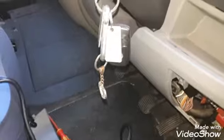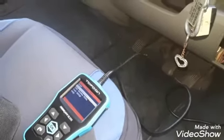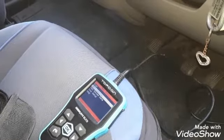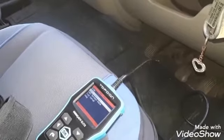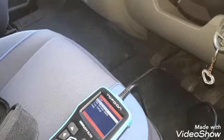Okay, I think I'll have to go back with this to the supplier of that fuel filter housing and request a replacement. Obviously, if I keep running the engine like this, that connector will get flooded again, and then it will show a fault on the engine as it did before. Because when I replaced the fuel filter housing, it was all good for X amount of miles until I took it to the MOT test center and they tested the vehicle, and it was all fine, and it was literally on my way home that the ECU fault came on. So I would imagine it would probably take maybe half an hour of running the engine for the engine management light to come back on.